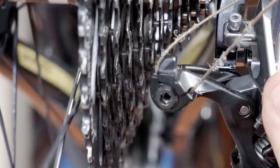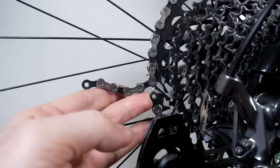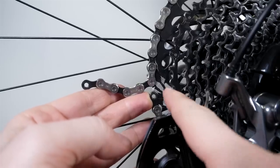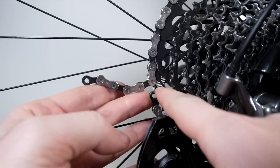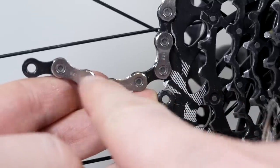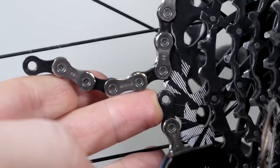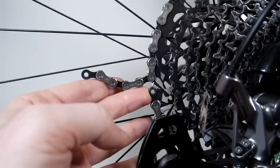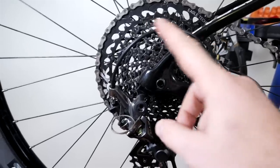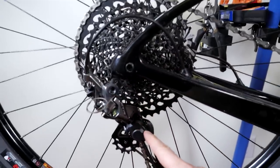Don't mind my hairy inner cable — I'm going to replace it before I start riding. Chain length recommended by Shimano is almost the same as recommended by SRAM but may be easier to measure. They ask for big-to-big, which I have here, plus four or five links, and they recommend four or five plus the quick link. So I'm definitely within their specs for hardtail. Just be aware that the housing needed here for XTR is definitely longer than what Eagle requires.